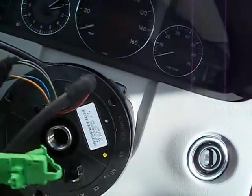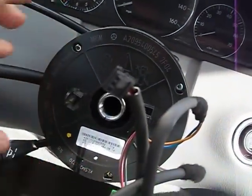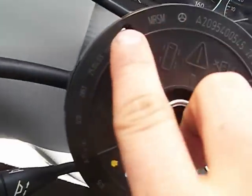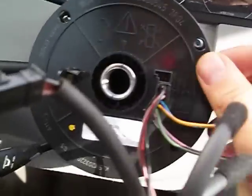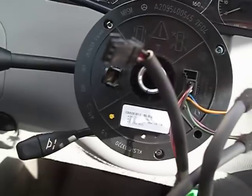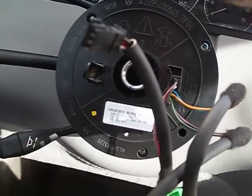This is a little bit tricky — you don't want to mess with this too much or you will have an error when you put it all back together. If you take off the clock spring, you've got these screws — they look like they are torx. So you just remove these screws and the clock spring comes straight up. That's all. And just to put it back in, you just go in reverse order.